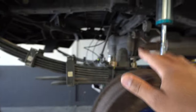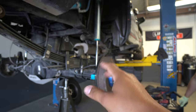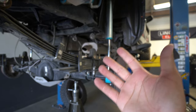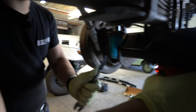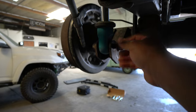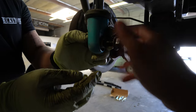This part — removing the bottom of the shock — is going to vary depending on what kind of shock you have. For me, I have a lot of travel, so we wouldn't really have to remove it, but we're going to remove that bottom bolt just to play it safe. Since the Stage 3 Deavers I'm putting on are slightly bigger, we don't want to struggle getting it in. You'll see we use an impact wrench on one side and a regular wrench on the other — that's going to be a size 19 millimeter to remove the nut and bolt. And just like that, we're good. We'll put this back so we don't lose it.